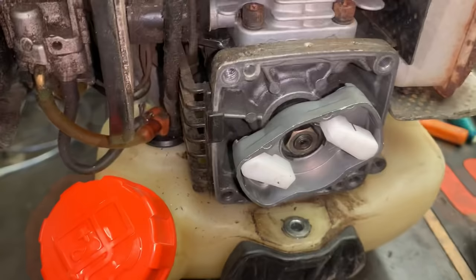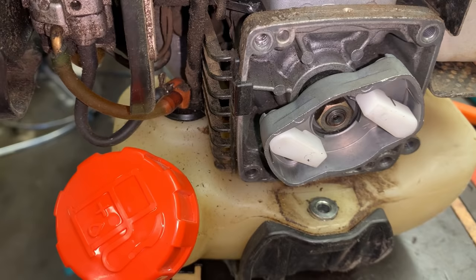I love being able to fix something easily this way. The other alternate method would be to drill that out, tap it to the helicoil size, and then install a helicoil — and then you could reuse your original screw.